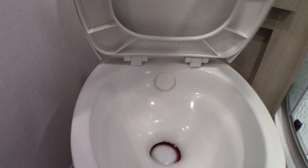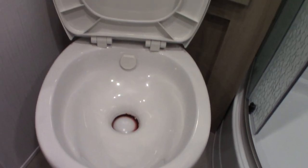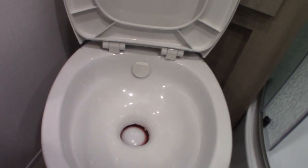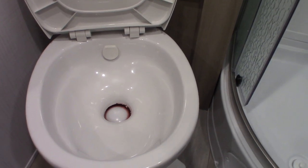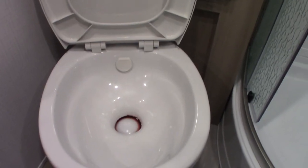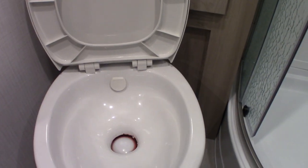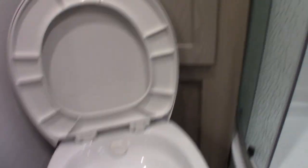There's the same model fan in here with vent covers on it, so you can open it during rain and it's still covered. When it comes to the toilet, it's a typical RV toilet that sits right over the black tank, with a flush pedal. When you get to the campground, hook up your power and water, then put a dose of chemical in the bowl. Stand on the pedal, push it down, and let at least a gallon of water flow into the black tank along with the chemical — then it's ready to be used. Don't use less than a gallon. If you don't do this, it'll get clogged for sure and smell terrible. You'll probably only make that mistake once.